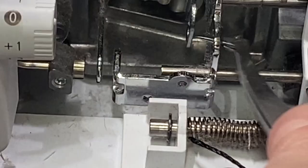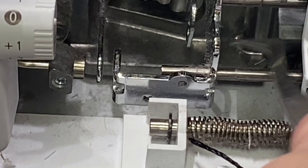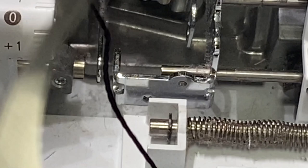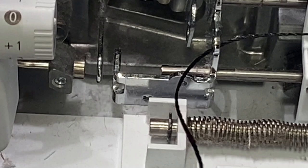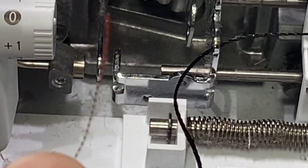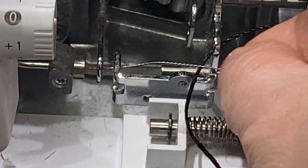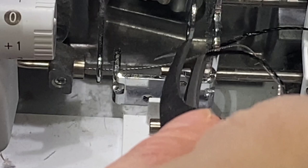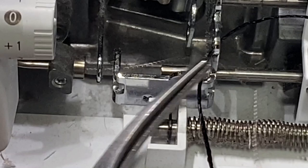The closest hole in this area — you've got the back one that threads your lower looper, but this is the cover stitch looper that we want to thread. We're going to carefully use our tweezers to feed that right through there. Now I'm going to take my little wire — it has a red tip on the end — and feed this wire all the way through my area down there. I use my tweezers to grip this wire and continue to push it through the machine.